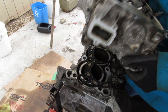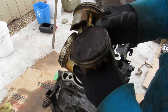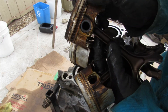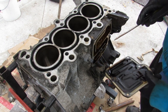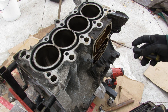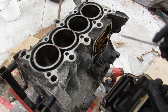Now I can pull the head off the block. Here we have the head gasket — it's a multi-layer steel gasket. I can reach in from underneath and pop these pistons out. These pistons look pretty rough — a lot of carbon on top and the oil control rings are completely clogged up. Peeling off this little cover here reveals this maze contraption, which is your oil separator. It's basically part of the PCV system — the oil gets trapped and falls back down in this little labyrinth, whereas the vapors get ventilated back into the valve cover.